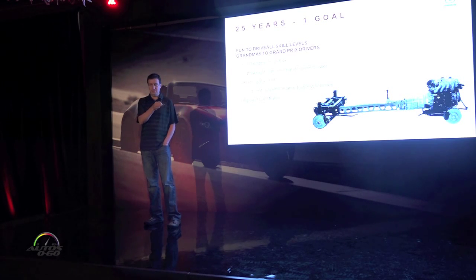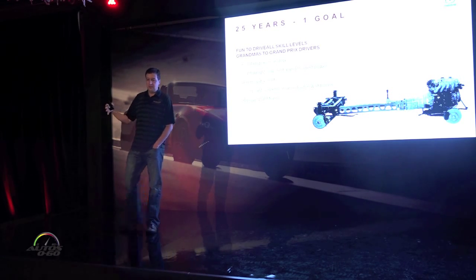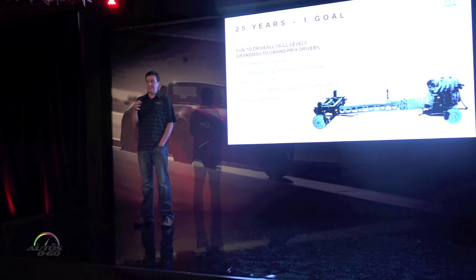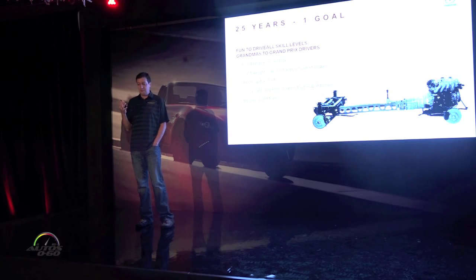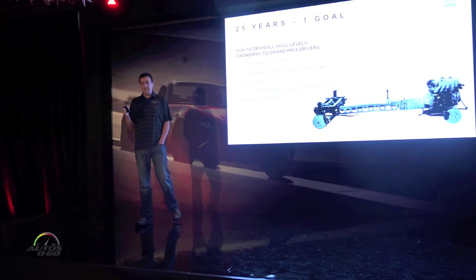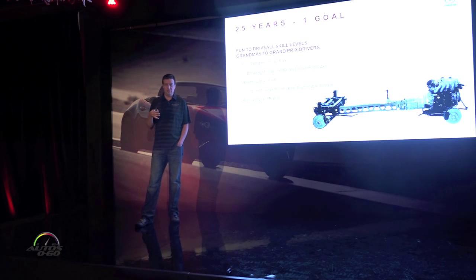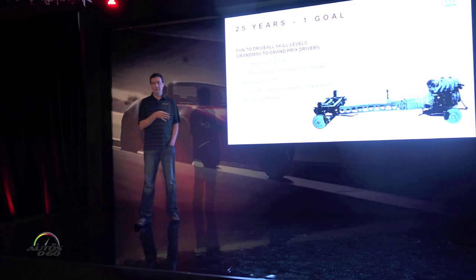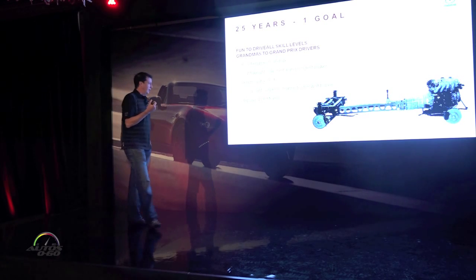The line between having a balanced amount of power and too much power became clear to me when BMW went from the E36 M3 to the E46 M3. The E46 came out with the fantastic S54 engine — an 8,000 rpm, 330-horsepower monster. It's a great engine, but they actually had to make the car more understeering than the E36 had been, so that when you're on throttle using all that power it was then perfectly balanced. Driven hard on a racetrack it was brilliant, but on a twisty road it was much less involving than the E36. That's a real tangible example of what too much power can do to a car.